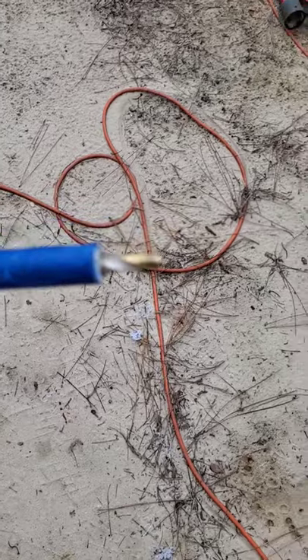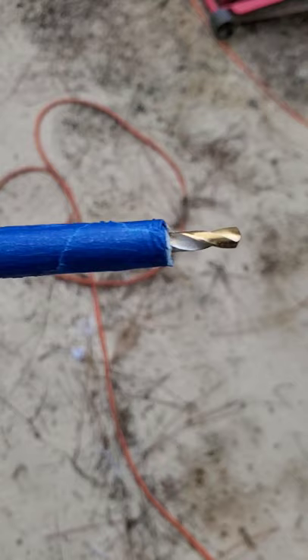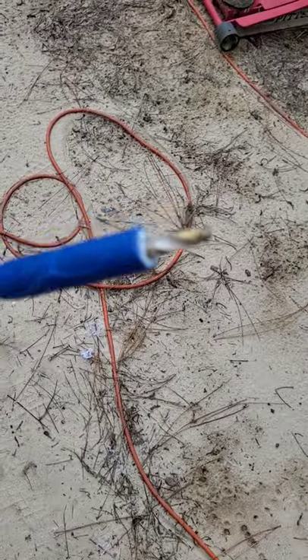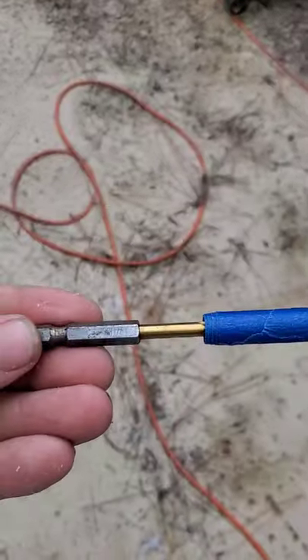Next I've got the piece of cutting board — it's a 1-inch cutting board that I've drilled. I used the Atwood rod holders as a template and countersunk the holes so that the new screws would fit flush. I'm just going to take that and test fit it. The bit I used to drill out the existing holes on the boat was 11/64ths, with tape on it so I didn't go too deep.